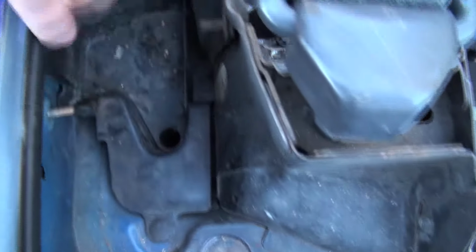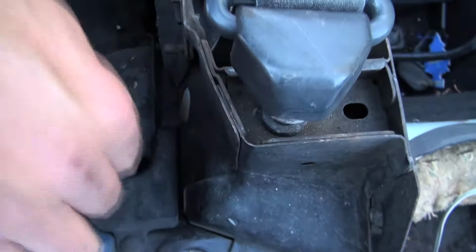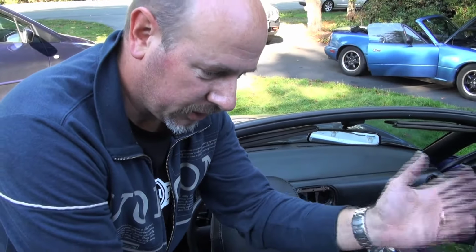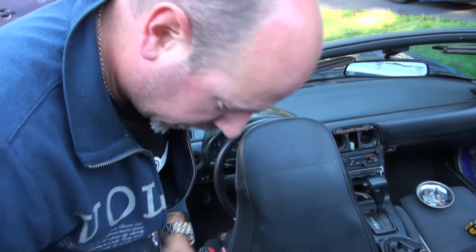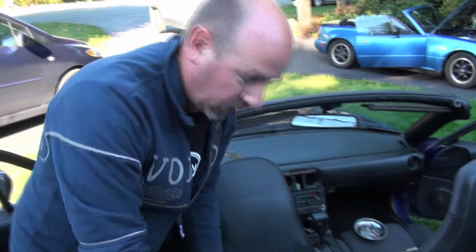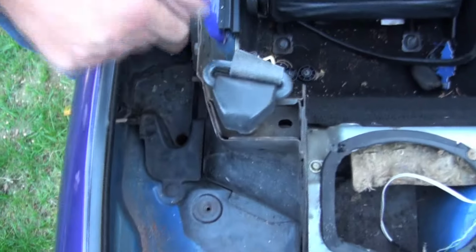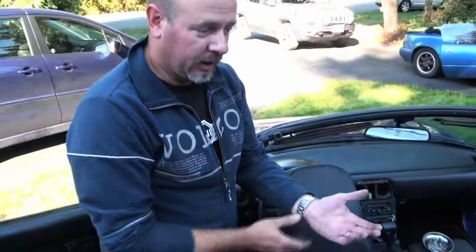And these are the drains that we talked about. So when these get plugged, you can see how much stuff ends up in there. You find all kinds of stuff in here because usually people throw things on the rear deck, sunglasses, purses, socks, whatever it is. It always ends up in here when you take a corner. So there's all sorts of debris, all kinds of interesting things end up in there. So while you've got the top off, take a coat hanger, carefully put it through there and clean out all the dirt. Take a vacuum cleaner and suck all the debris out. And that way you know that those are clean before you start putting the new top back in.